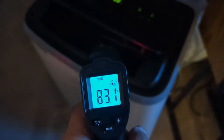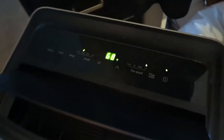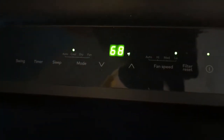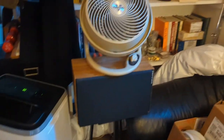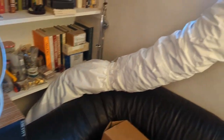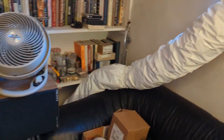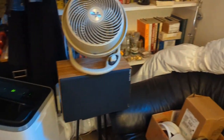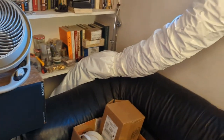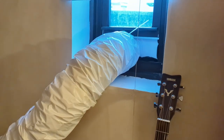Just to double check the Frigidaire: 39 degrees coming out of that Frigidaire, and it's set at 68 degrees. And that is the Frigidaire portable air conditioner, 13,000 BTU, with an extended hose with an air duct elbow inside. Hope you liked this video — give me a like if you like it, and subscribe for future information and adventures. Be well.